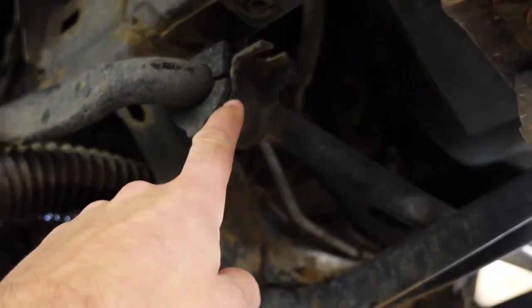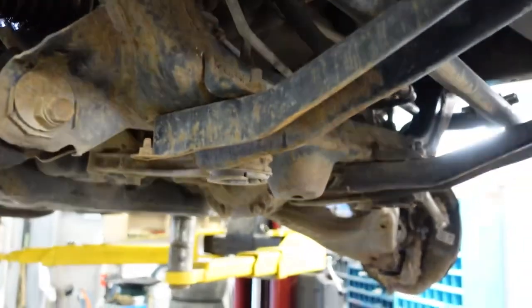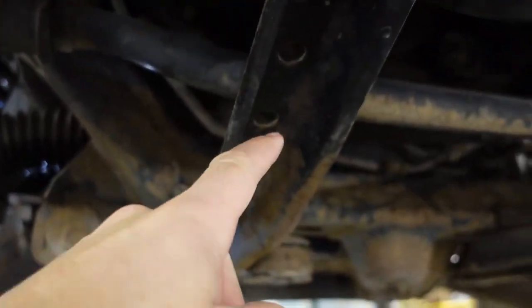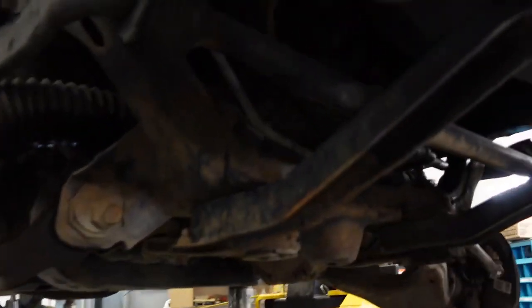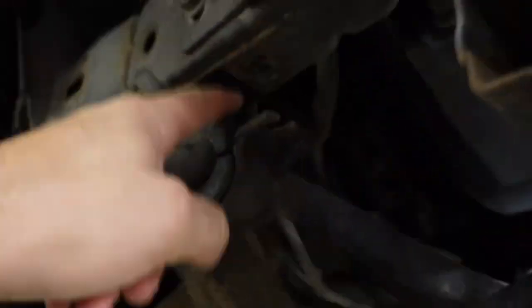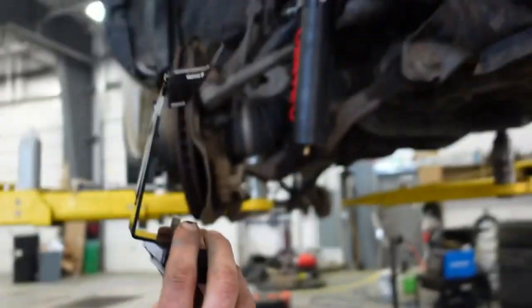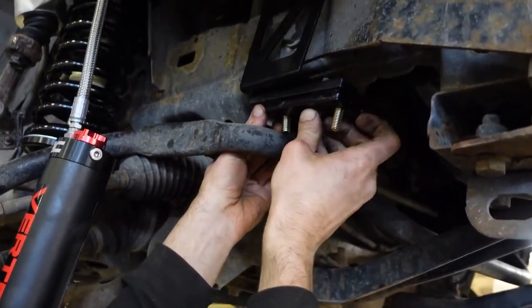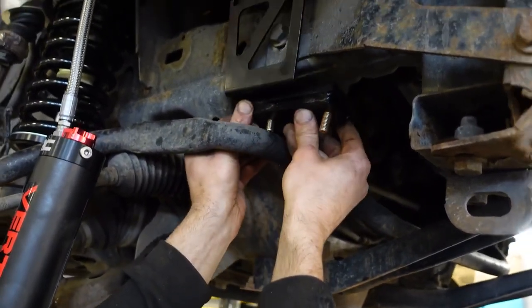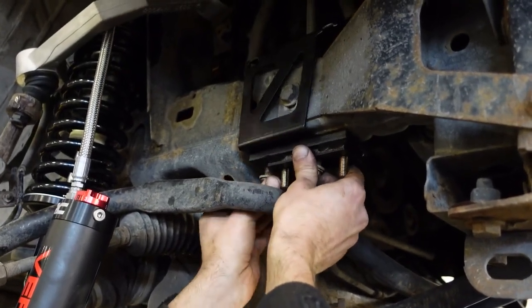Sick. So we've got the sway bar bolts out. We're going to put our spacer in there now, and then our reservoir bracket will be up here. And Serge, you said in the instructions it noted to notch these rod support brackets. All right, so we're going to notch these and put our bracket spacers in here. Oh, that looks cool. It's got a little well thought out Rough Country. And then this goes up in here, like that. Because you read the instructions, now you know that. Definitely did. Always reading. Look at that, there you go.